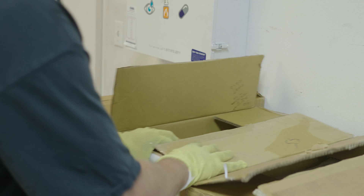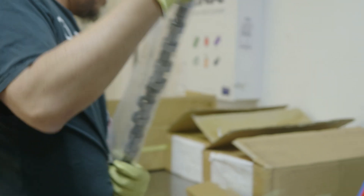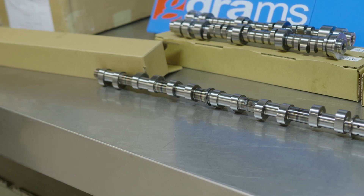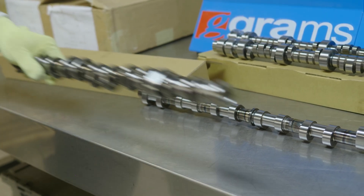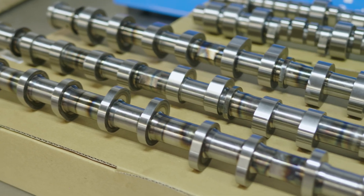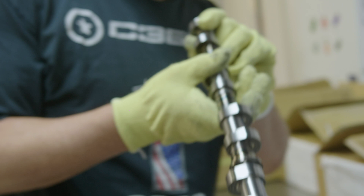First box — probably the most exciting cam, and by far this was the hardest cam to develop. It's actually not a Honda cam. It is a Supra cam — Supra intake cam and Supra exhaust cam. Now these aren't 2J cams. These are BMW B58 and BMW S58 cams. Too many people already doing the 2J stuff, no reason for us to do that. But these B58 and S58 cams — it's not easy. If you look at the lobe, see how it's almost inverted: the base circle is small and then the lobe is really big.